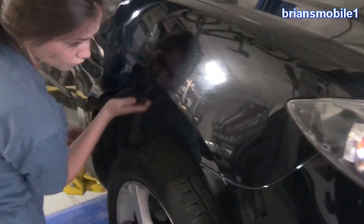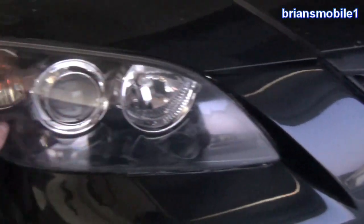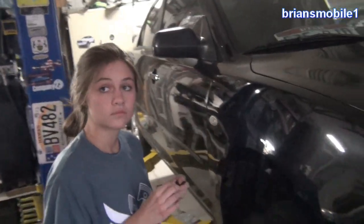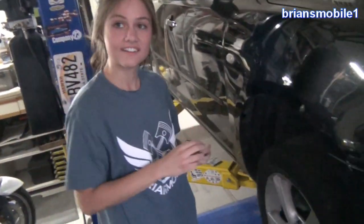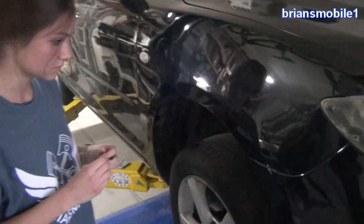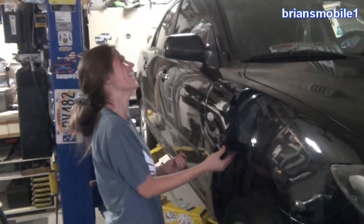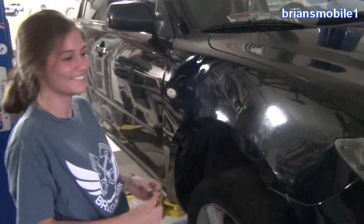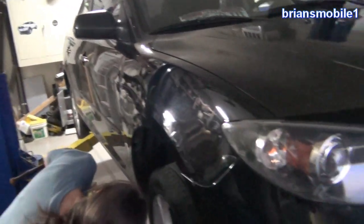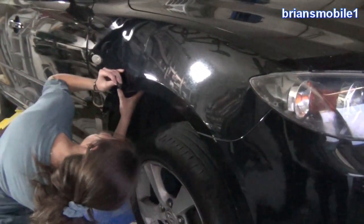It's a little darker outside. We had an hour of light to get things done, and pleased to report it looks a lot better. The nice thing, especially with the headlights, is that they're a lot safer. These will fade again because there's no clear coat on them — it'd be a good idea to clean and polish these up and then spray them with some clear coat. Otherwise it'll last maybe six months and then be foggy again. But that looks way better — you can hardly see the dent compared to all the other ones. That's just my neurosis of wanting to fix everything — everything has to be perfect and it never will be. I pay it tribute and let it go.